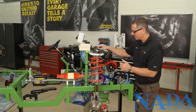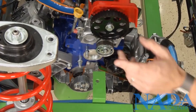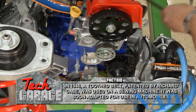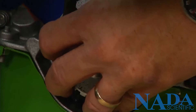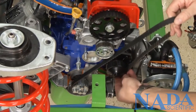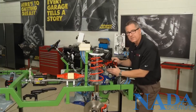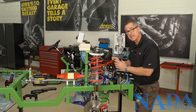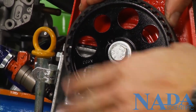Before we put our belt on, we need to do a couple things. First, I want to loosen up the tensioner — remember we cut our belt off, so we need to get that loose where we can put the belt on. Then I'm going to come down here; I already put the crankshaft in time. You see these two marks right here? The crankshaft has to be in time with the camshaft. So I'm going to take my belt and work it on the crankshaft first. Once I get it on the crankshaft, make sure it's in the teeth — and also look at your tooth profile: some are round, some are square, make sure they match the pulleys. Come over to the water pump, get it on the water pump, and then come around the tensioner. But before I time the camshaft, I have to make sure these marks are in order. Check your service manual to find out where these timing marks are, because we talked about that choreographed dance between the piston and the valves, the camshaft and the crankshaft — this is what's causing it. Come around here and just slip it on. Make sure it stays and make sure your marks are in order.